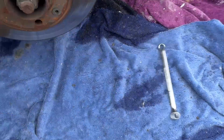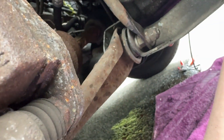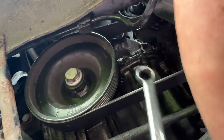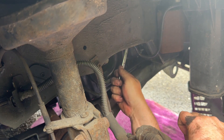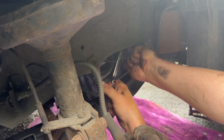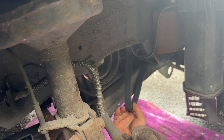To remove the serpentine belt all you need is a 13mm spanner. Some versions have a tensioner that's bolted in, but on this one you put the 13mm on the tensioner — just above the crankshaft pulley — and as you can see it moves. You need two hands. I removed it off the crankshaft pulley; I was going to remove the whole belt but the series of pulleys towards the aircon unit were really tight. If you're not replacing the serpentine belt and you take it fully off, make sure to draw arrows on it showing its direction of travel.